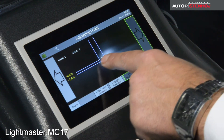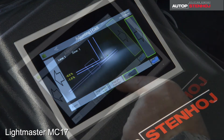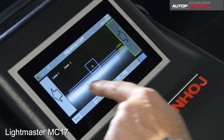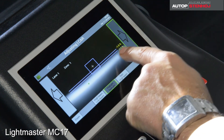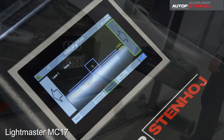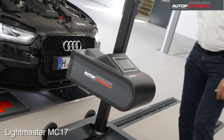There is an extra menu for dynamic light systems with the appropriate setting lines. According to the light system you are checking, you have different setting lines and vertical limit values, so you can adjust all major light systems. Make your selection and check the vehicle on both sides if it complies with the requirements.